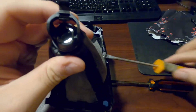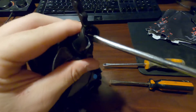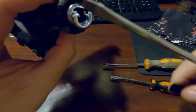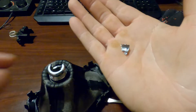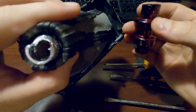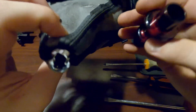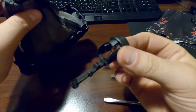I took another screwdriver and did the same thing on the other side, so you have two screwdrivers sticking out like this. Then I wedged a third one in here and it was really hard to do without breaking the plastic. Once I wedged it in, I kind of worked it out and this whole entire thing just popped off — also stabbed myself in the process. But when I wedged it, the wall right here just cracked. Here's a piece of it. That's a bummer, but I am replacing the reverse lockout. So if you're replacing this and still need the old piece, be more careful than I was. But we need this plastic piece — this is the important bit — and it's unharmed, so that's good.